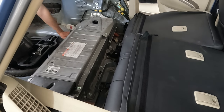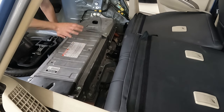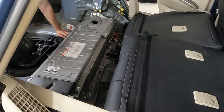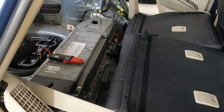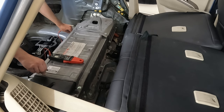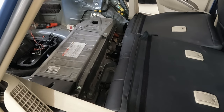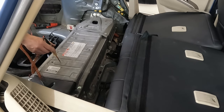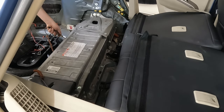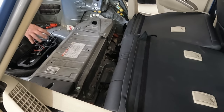Before we touch too much, you see it says right here: danger, high voltage. If there is some sort of acid or battery chemistry leak onto this, it could be charged according to the manual. I've never had one do that, but because it's a possibility, what we want to do is take a voltmeter, set it to volts DC, and touch around the box without touching the box ourselves — we should get zero. Another option if you don't have a voltmeter is a test light. Touch one lead and start touching the case. If the test light lights up or burns out, then you know you have a problem. Because this is high voltage, we just want to be super careful. Now that we know it's safe to proceed, let's start unbolting.